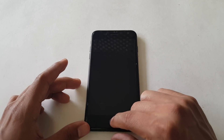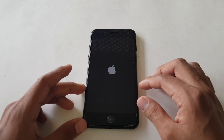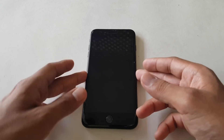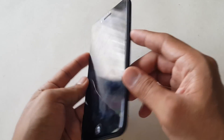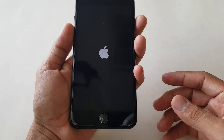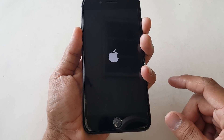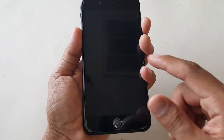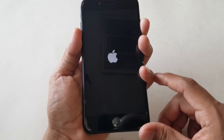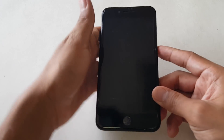In this case, the problem is going to consistently happen — it's always going to happen if the phone powers off. There's no way of actually getting that fixed until Apple fixes it themselves. What you're going to do first is hold the power and the volume down to get it to recovery mode. But since it's boot looping, let it power off, then let it power on again, and once it powers off you're going to release the two buttons.